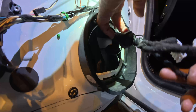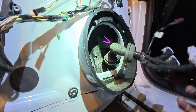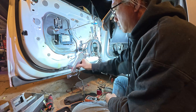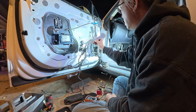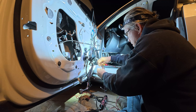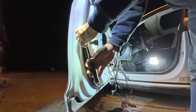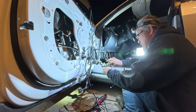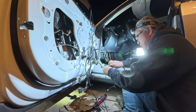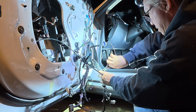So here's where I'm going to save you a lot of time. The problem is in here, nowhere else. At first I was going to be thorough and check every wire end to end — I used a toner to find the wire ends and a continuity tester to check for broken wires. But to get to some of the wire ends I had to remove this cover, the door latch, and the window regulator. I wasted like two or three hours before I decided to just go straight to the suspected problem area.